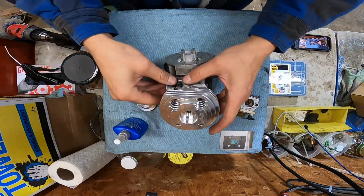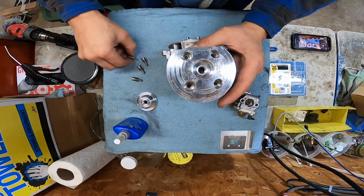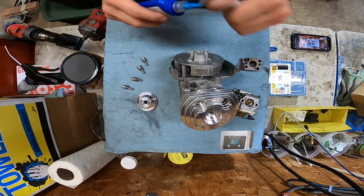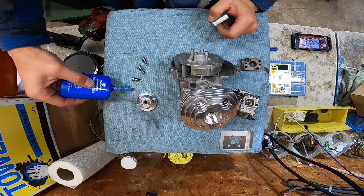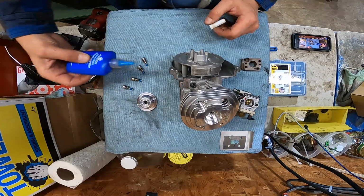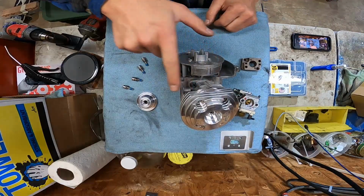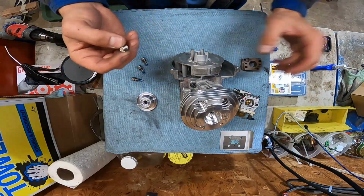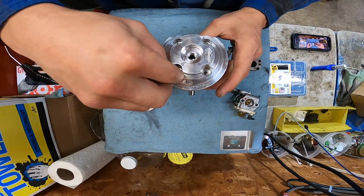Alright, I think what I'm going to do is, oh, it's kind of dirty in there. Well, let's just go ahead and put this on. The dangerous thing with this head kit is that I need a bracket for the coil, because the coil is only going to be held on by one bolt, which is scary to me. But I believe that's how this thing was before. I'm terrified that this post is going to break off and then lock it up, which was common with some of the Sick Toy RC head kit engines, if I remember right.